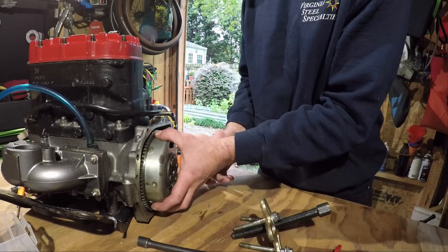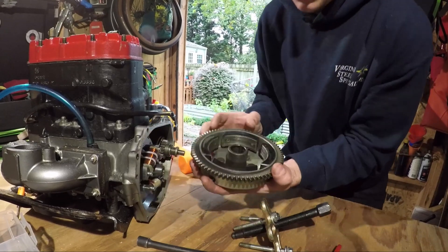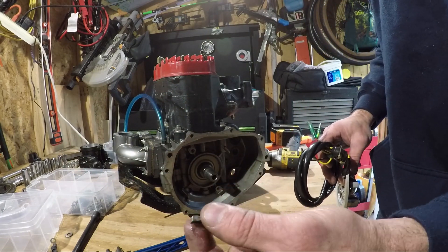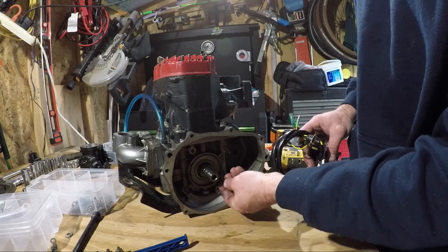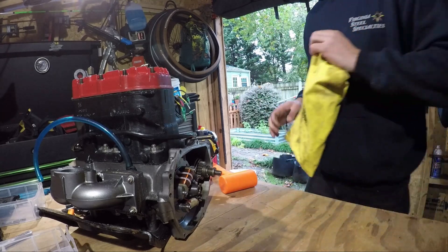The flywheel is lined with magnets, so don't be fooled if it feels a bit stuck to the stator, even after clearly being freed from the crank. Also, locate the Woodruff key and put it somewhere safe. If it seems damaged, you can replace it with the 13mm keyway, 3mm wide Woodruff key from McMaster-Carr. I had to buy a pack of 25, so feel free to comment below if you need one — I don't mind mailing you one.